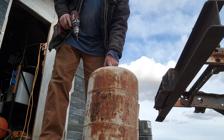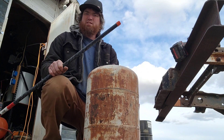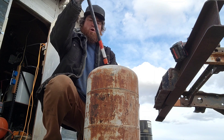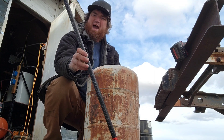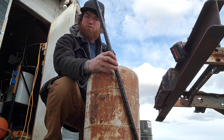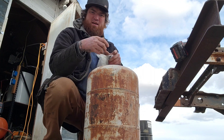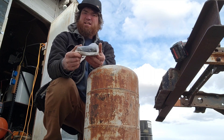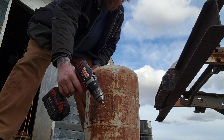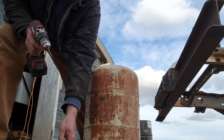The valve that we took out is actually 3/4 inch MPT. That 3/4 inch MPT we're going to adapt to a 5/16ths barb and have our return line going in there. We're going to drill a hole and put this half-inch pipe - cut it to the right size so it goes all the way down to the bottom - then adapt to a 3/8ths hose to feed our engine. And for the filler neck, I've got this inch-and-a-quarter pipe, so we're going to cut a hole and weld that up as well.